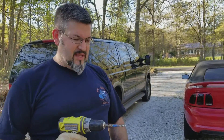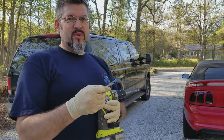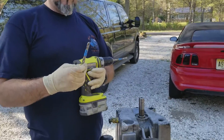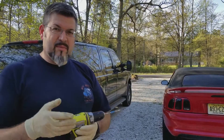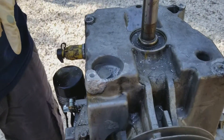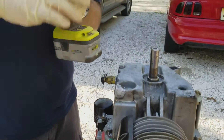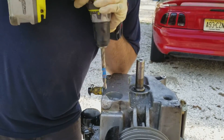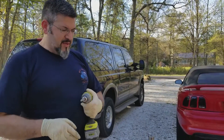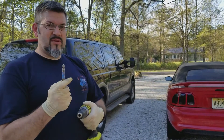What I'm doing here is I drilled one smaller drill bit in size instead of going straight to the largest bit. I started from a small one to a bigger one up to this size — stepping up the size makes it a little easier to drill a solid piece. I actually used four different drill bits to get up to the final size, which was 13/32nds.